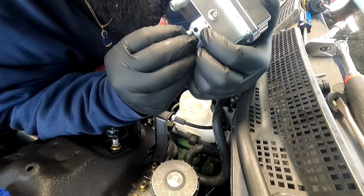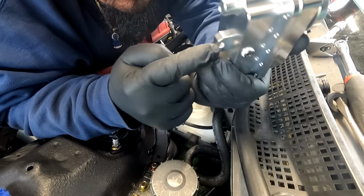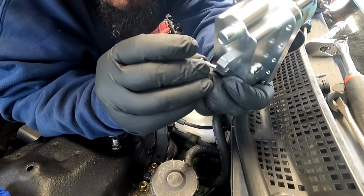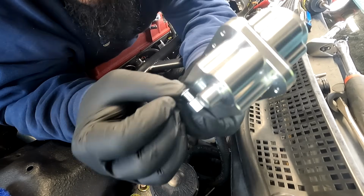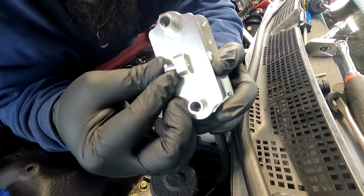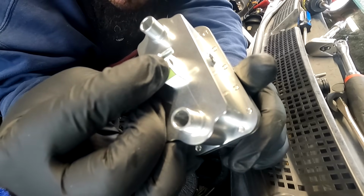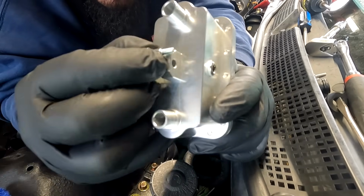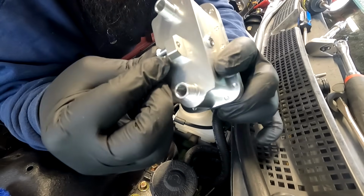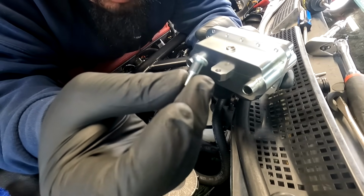I think the only way for me to make this fit, since this is not an OEM unit, is to enlarge this hole to fit the shoulder bolt. Just a little bit. Does not fit. And once I enlarge the hole, it should go out enough to thread into the aftermarket brake master. Now, if you're running an OEM unit, this should fit, because I just showed you guys that. On my digital caliper, this shoulder bolt was like 5.8 millimeters.